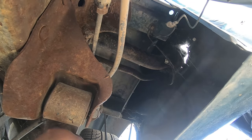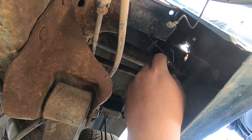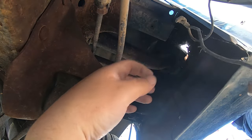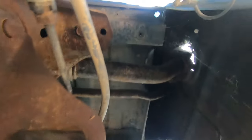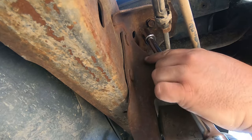We're going to get underneath the bed to remove it. This is the fuel neck door. We have a ground strap here - just take out the bolt and let the wires hang because I will be removing the bed. We've got a series of 18 millimeter bolts, about eight in total holding on the bed. Get a big extension socket to get all of them out.